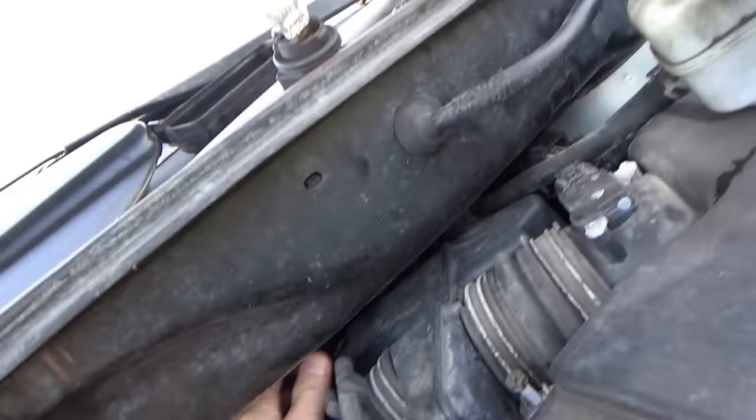All right, so when I was showing the technician here what the issue was, we actually spotted the root cause of the problem. When I was lifting it here, and the short goes away, there is indeed something poking the bottom of the harness. See that right there? Let me show that on camera. I'm just gonna lift the harness up off of that. Look at that. It's a sharp self-tapping screw. Wow, cut right into the harness.